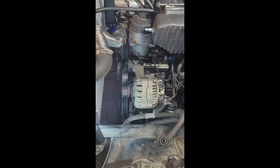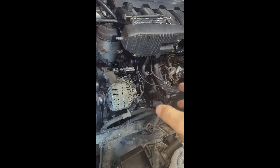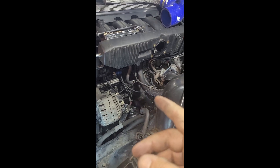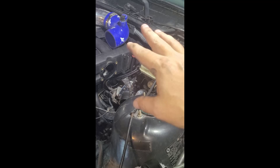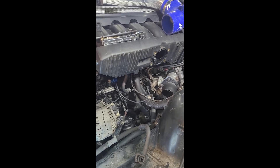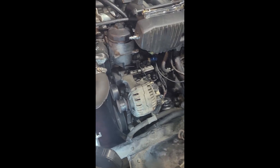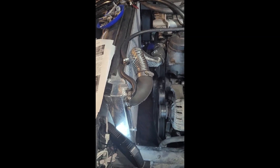Step one - if you've gotten this far, then you're good. If you haven't seen my other video, make sure you take a look at it. It's going to discuss deleting the crankcase ventilation, deleting the secondary air pump from the far side and all of those lines, as well as removing the air box or cold air intake if you have one, deleting the ABS and the traction control throttle body, and also eventually relocating the throttle body. You're going to have to cut the wire loom, reposition the throttle cables, rotate the throttle, and if you're like me, I even deleted the water intake and outtake off of the throttle - the throttle heating circuit. Watch the other videos; they'll be in the comments and they're on my channel. But if you've got this far, you're ready to put the supercharger kit, bracket, and everything on.